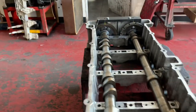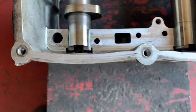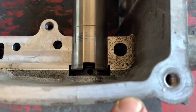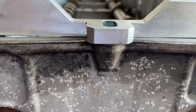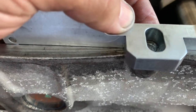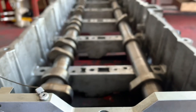The other piece of equipment that comes with the timing tool for your cams is this little pin tool here. It gets installed right in there — you'll notice it's literally cut out perfectly for it on both ends. If you look down inside, you're going to see that little opening, and those openings are where these little black pieces on the tool are going to sit. Once you install it, it should literally just go right in — nice, flush, and smooth. There's also a small opening where you can secure it with a bolt. Once you do that, your timing is confirmed. At that point, lay down all the bridges, torque them down, and go from there.